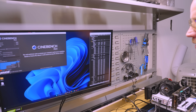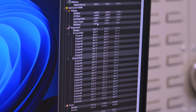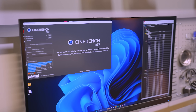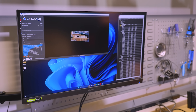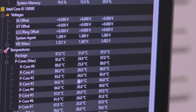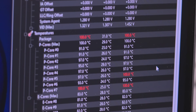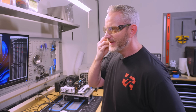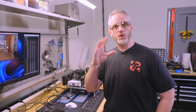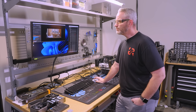Here's what we're looking at: P-core and E-core temperatures are chilling in the 20s — no different than our AIO until we go under load. The voltage right now while idle is at 1.434. Let's see what happens when I start the test — it will droop down. 1.307 under load. 94, 93, 95 — the cores are all in the upper 90s. It's not throttling, 332 watts. There's 100°C. This whole overclock was sort of set for — it's only a 38,586. I definitely throttled a little bit, because on the water cooler I was able to hit like 40,600. So right around the 37,000-and-change mark.